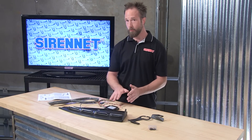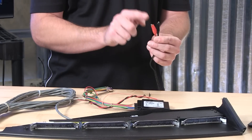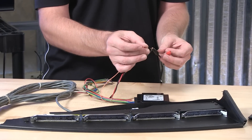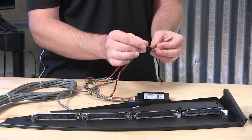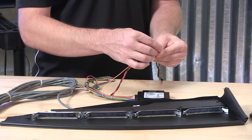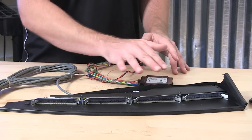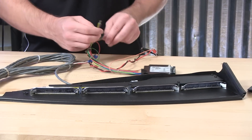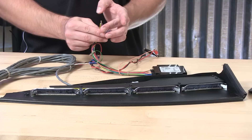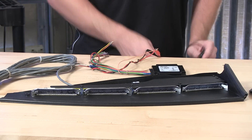I'll go ahead now and put connections to the pigtails here to give you an example of how this will work for you. Taking a set of clips — ground lead — and connecting them onto the pigtails here. The Enforce bar itself and the breakout box both need to be supplied with power, so you'll have a trigger wire running from the harness on the Enforce bar and from the breakout box as well. Connect those to power, turn on the unit, and you are now ready to activate the warning mode or the takedown function. Taking a set of four trigger wires — color corresponding to the install sheet to match up with the function that you need — each one controlling one of the modules, and applying those to power will activate the warning function.